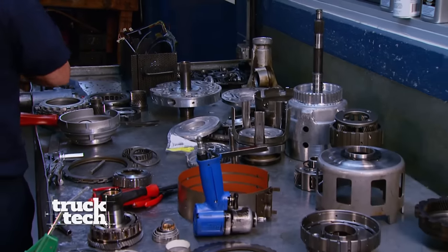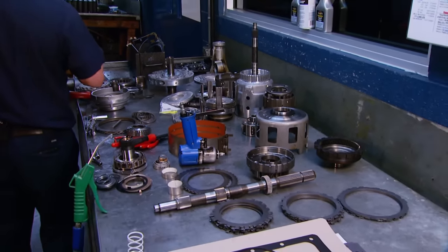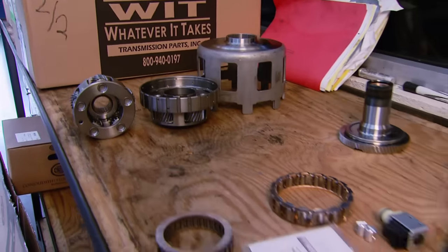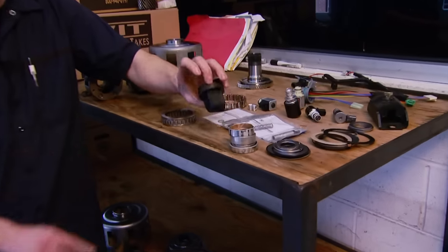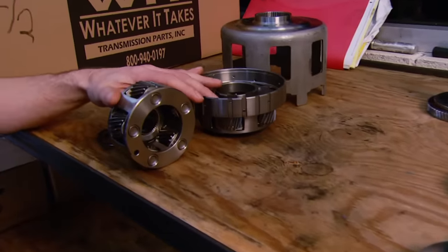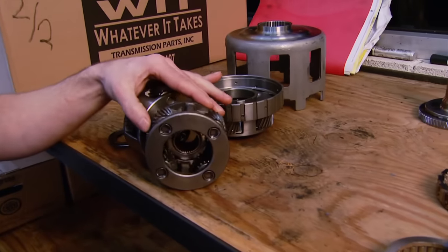Welcome back to Truck Tech. Here at our local transmission shop, Jamie, our lead tech, is rebuilding our 4L60E using our kit from TCI. We're also throwing some new parts at this thing: new solenoids, bushings, bearings, valves, sprag clutches, and a new speed sensor. We're also upgrading to 5-pinion front and rear planetary sets, which is obviously stronger than the factory 4-pinion version.